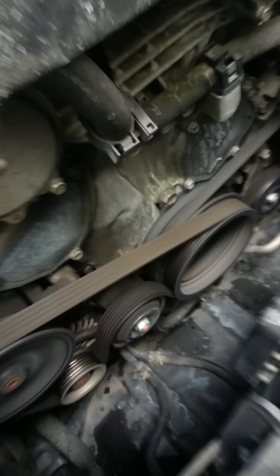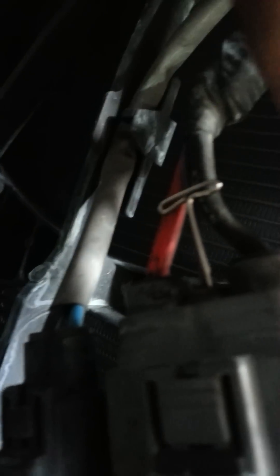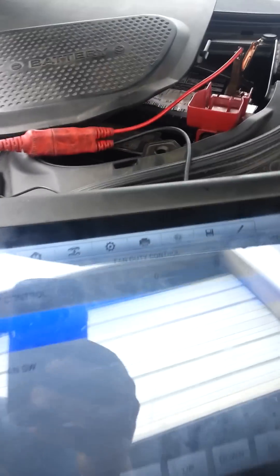To make sure exactly what's wrong, I'm going to show you. This is the control module right here. I've got my power probe on it — you can see the purple wire. As you can see, it's backwards but that's 0.3 volts, and that's on 0% duty cycle.